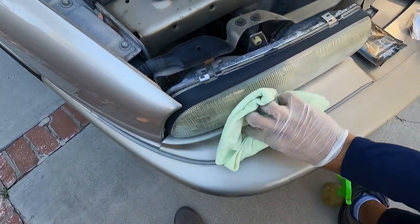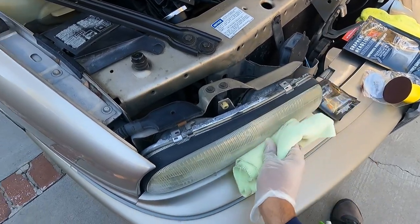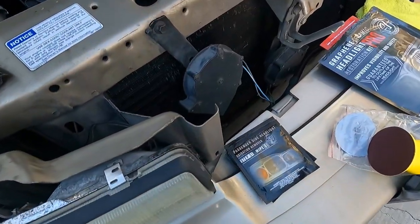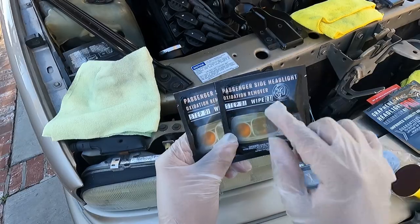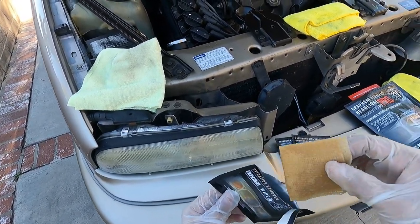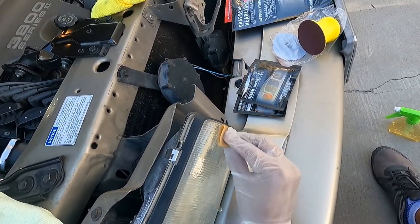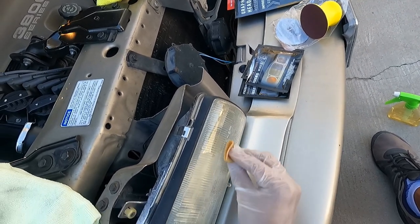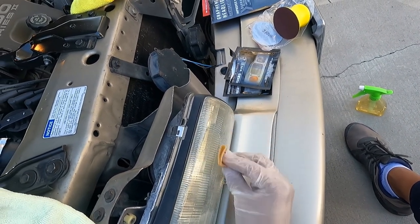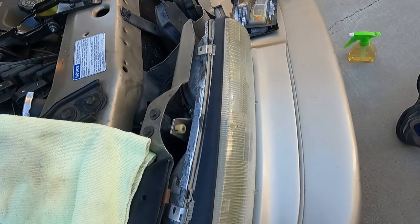You can hear it — that's just grinding against the headlight, so this headlight probably needs to be replaced. We'll see if sanding fixes it. With oxidation wipe number one and wipe number two, you're going to use them until you no longer have any clean sides. I'm going to fold this in half one more time — all you're doing is scrubbing the headlight. This is chemically removing all that oxidation layer. It only does so much — right here in the center this light is pretty messed up and technically needs to be replaced.